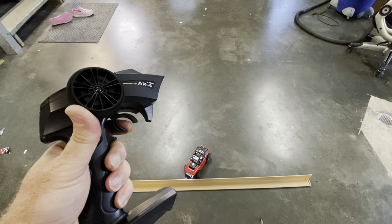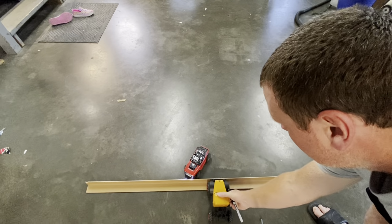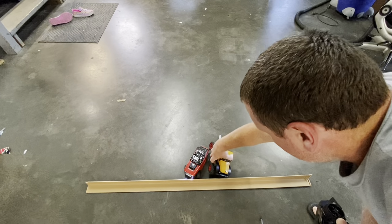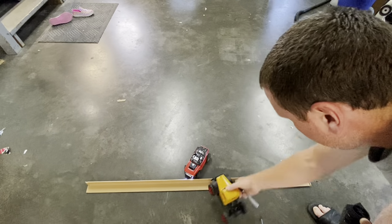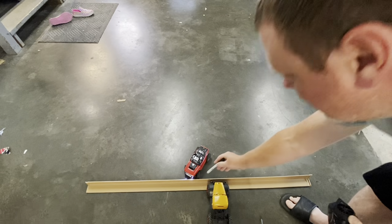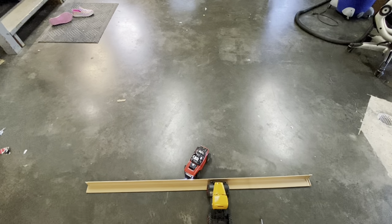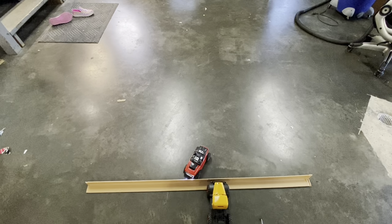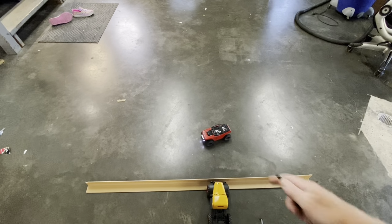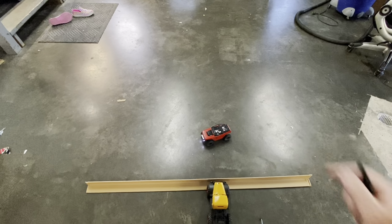Look at that. A better turning radius even. So here is the mark where the center of the tire was for the FMS, and there's where the SCX24 is, so we got close to 3 inches there. That's crazy for portal gears, but there are CVDs in there which allow better turning than the dog bones.